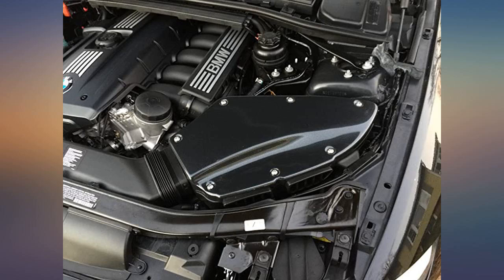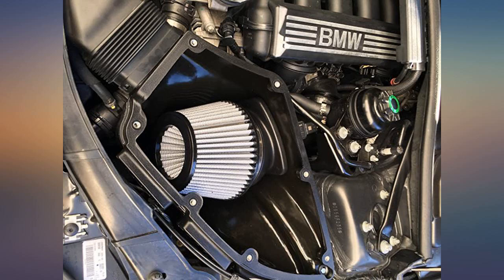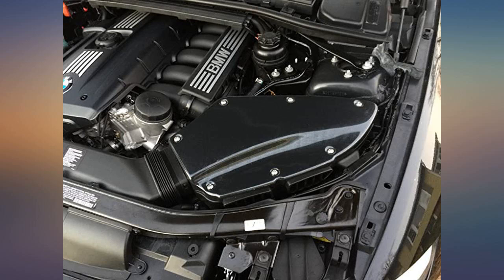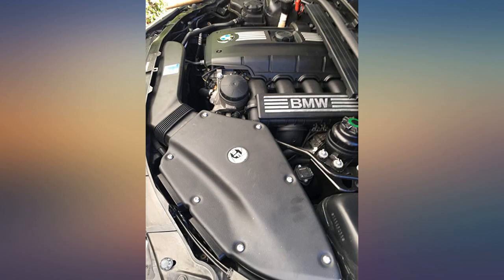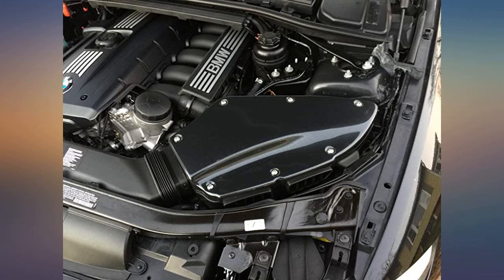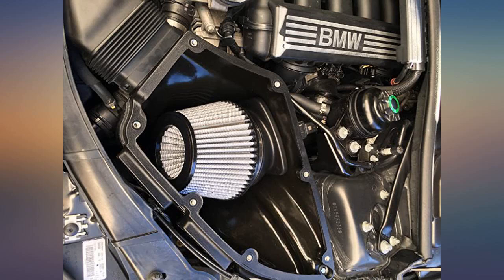You will feel that extra pull when you take off. When installing, don't assemble the unit then install it as a whole — take it piece by piece. Install the mass airflow sensor, put the intake tube into the housing, put the semi-assembled pieces into the engine compartment, connect the tube to the engine head, then affix the intake tube to the housing. Then all should fall into place. Not disappointed at all. The car sounds amazing.